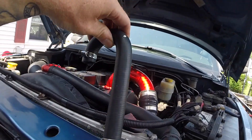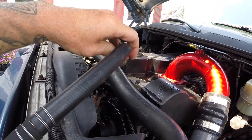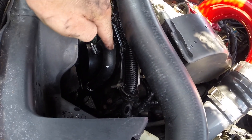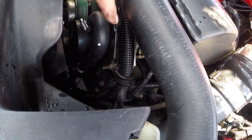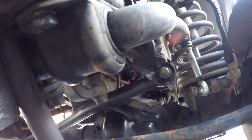I'm going to get this fed in place where it needs to be and route it down below, then tighten up the hose clamp and be done with this. Hose clamp is tight — it's tucked down low like I wanted. I routed it down and was able to tuck it in between the frame and the steering box and then between the anti-sway bar and my steering box brace, so it's routed out and away from the harmonic balancer.